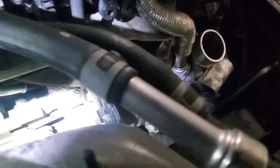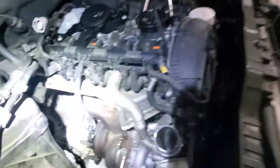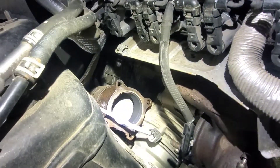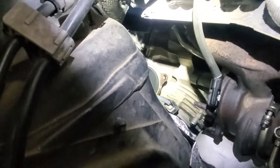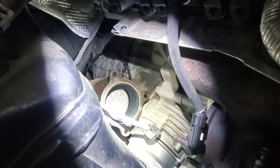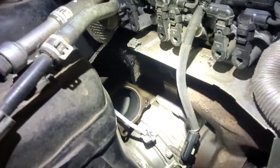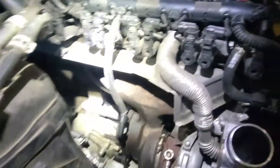If you've got an Audi, this is fairly common. What you need to do is pull off the catalytic converter. My technician said it wasn't too bad except for one of the bottom bolts — he had to get creative with a super long extension and a swivel, I think 15 millimeter.